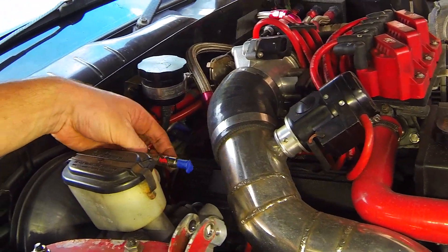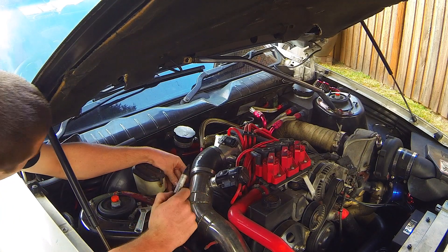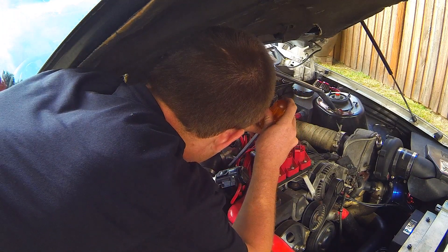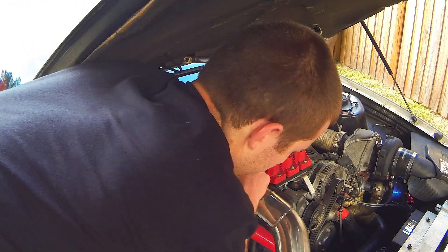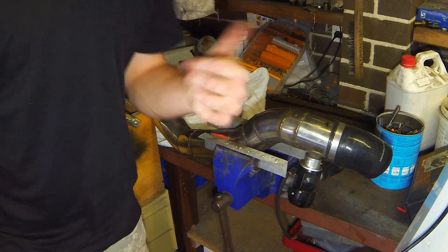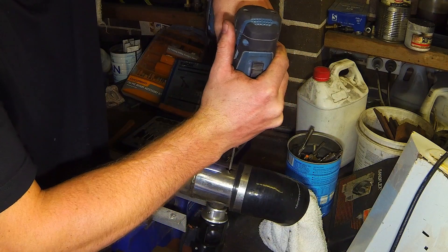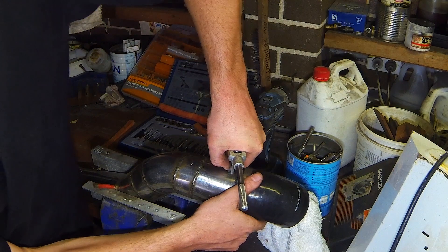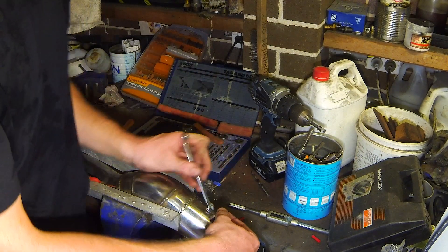There's not much slack or room in here, so I'm thinking somewhere like that. It's now just a matter of doing the highly technical job of marking it with a perma. I designed this to come off quite quick and easily. Get a drill, an eighth inch NPT tap, and some sealant — that's it. Stainless is certainly not the most fun metal to tap, so after a lot of stuffing around, because stainless is an absolute bitch to drill and tap, I finally got this hole sorted.